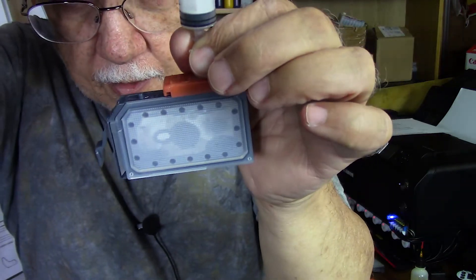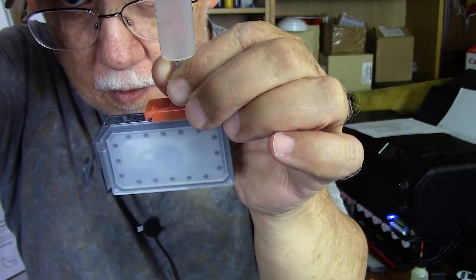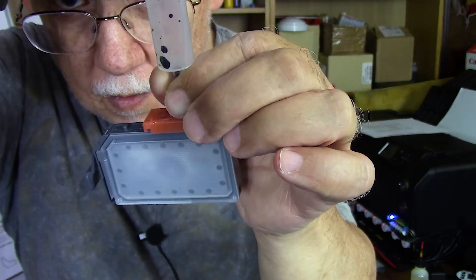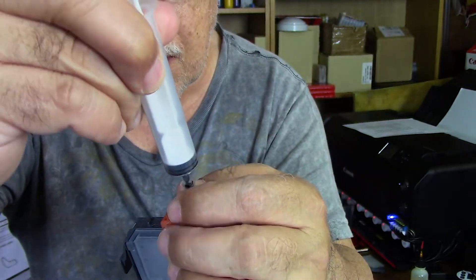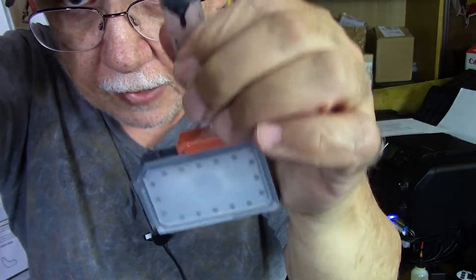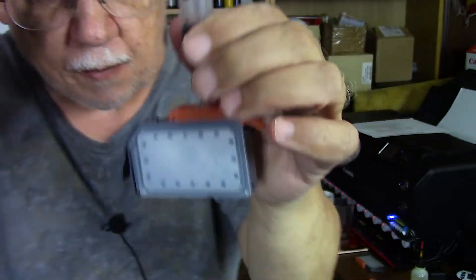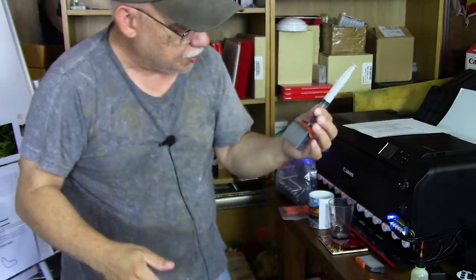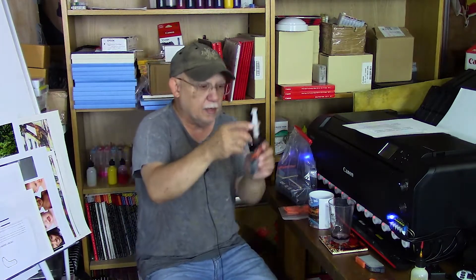Let me angle it — you should see that circle in the middle disappear. There — now I cannot pull back anymore, and I got a little bit of black ink in the syringe. That bag is now fully collapsed. I used a 10 ml syringe; you may need a 20 ml syringe because the internal capacity is close to 15 ml.